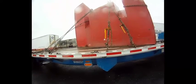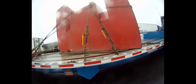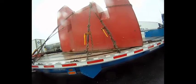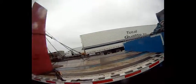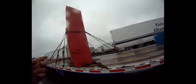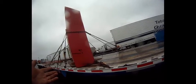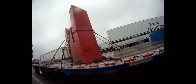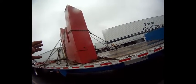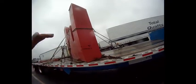That gives you an idea — it's tough because when you get a trailer and you know it's 48 feet you learn one way, a 53-foot flat or step you learn another, and this is 51 so it has a different setup for how it scales. This piece is 40,000 pounds. I know to set it forward of center to get close on weight. The drive axle was a little heavier — seven to eight hundred pounds — but that axle loses weight as fuel burns off, so as long as I'm legal there I don't care.